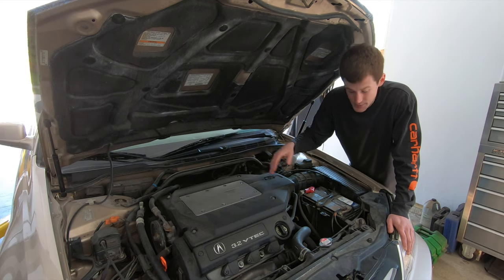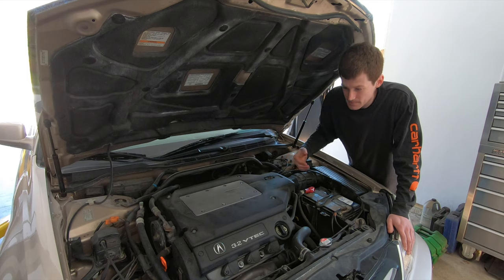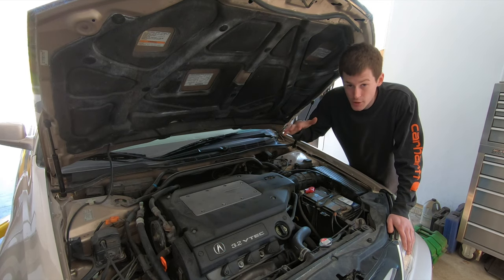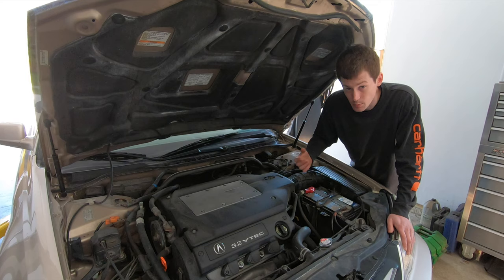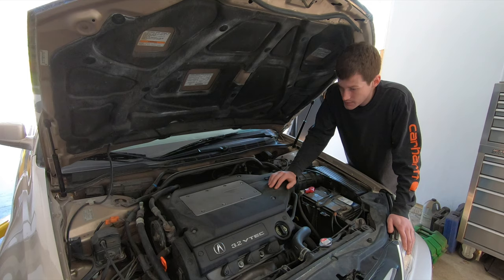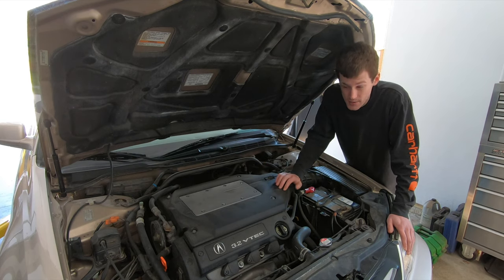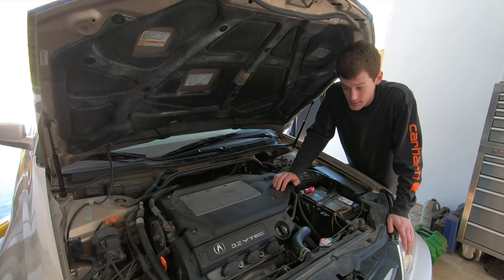If they're too tight, it's going to sound normal. But in my experience on cold start, you'll get a random shutter in the vehicle — it'll kind of cough and sputter a little bit when you first fire it up. Once the vehicle's warm, it runs fine. So I'm going to fire this thing up for you guys. I'm not going to let it run that long because as soon as I'm done here, I'm going to start tearing it apart and show you guys what gets out of adjustment and why it sounds the way it does.